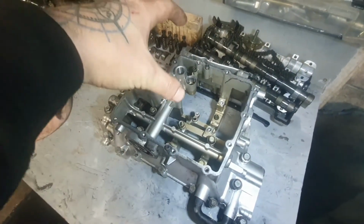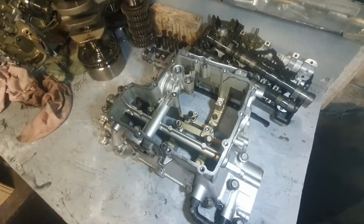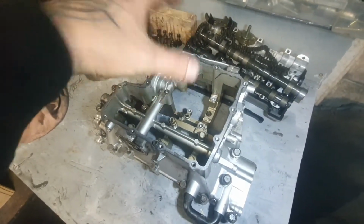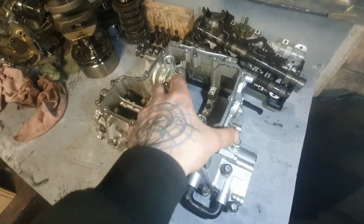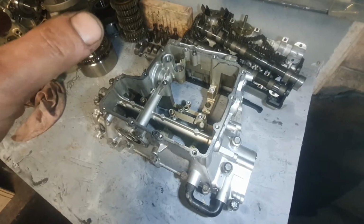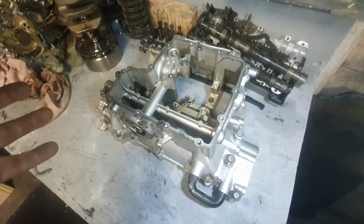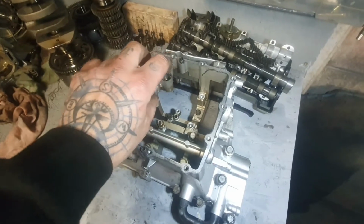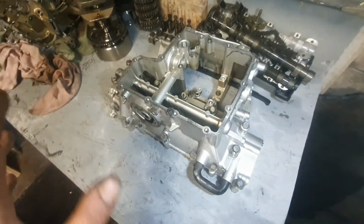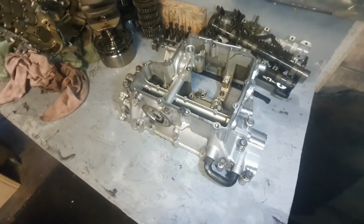the oil pump where the scavenger pipe actually sits and is sandwiched with the sump. I think that as I've been putting the sump on, it's somehow been knocked, because when I pulled the sump off of this originally, it came off with ease because obviously it's only been recently fitted, but the strainer was laying on its side. So I'm a little unsure, it could have fallen off as I pulled the sump off, but even so it didn't seem right to me.